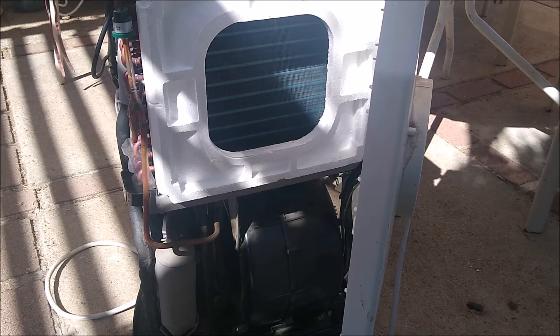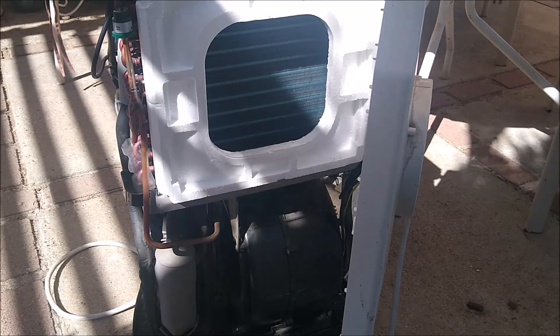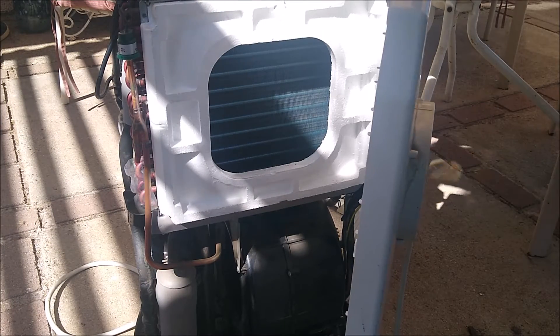At the same time, I installed a shop vac — just put the vacuum head down in there and turned it on while the compressed air was blowing out, and it sucked the stuff up. Then go and clean whatever is left. There are filters in the system, which I showed you earlier before we took it apart. You can see this one came out nice and clean. If a filter comes out dirty, then you know you're going to have some dirt inside. Both filters were very, very clean — just a slight bit — and that indicated there was really no dirt to be found in the system.